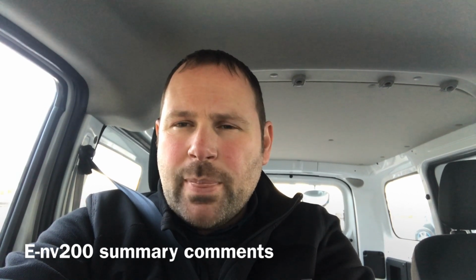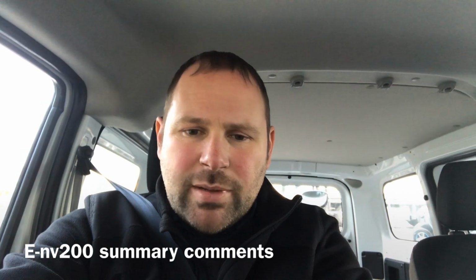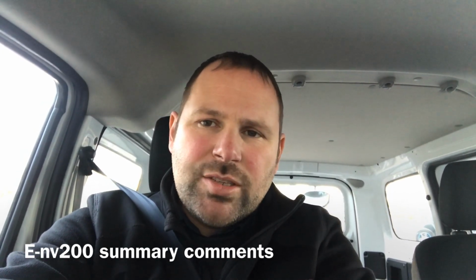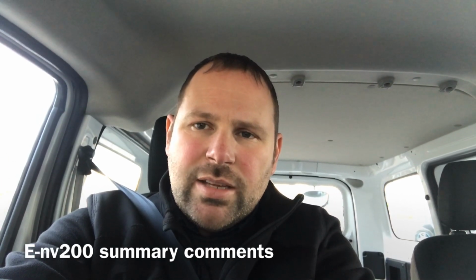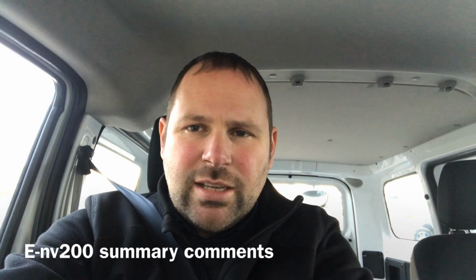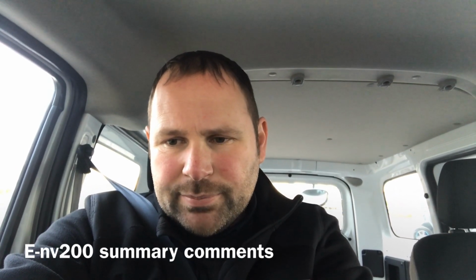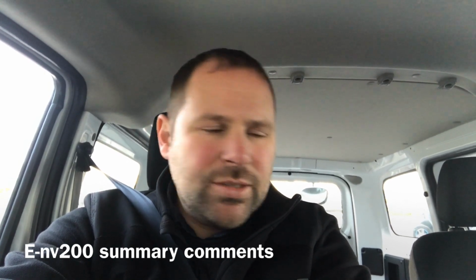Probably about 7 or 8 kilometers for each hour you have it plugged in charging, something like that on a regular household outlet in New Zealand. If got a 16 amp 230 volt, probably pick up about 17-18 kilometers of driving for each hour you have it plugged in, and a full charge in about 5 or 6 hours. That's my guess.